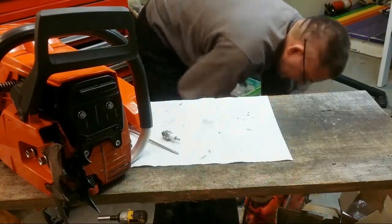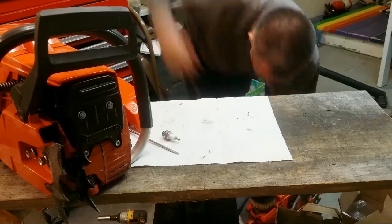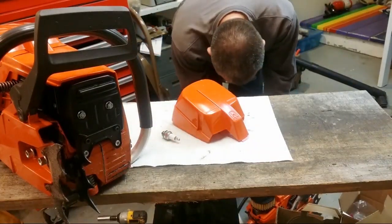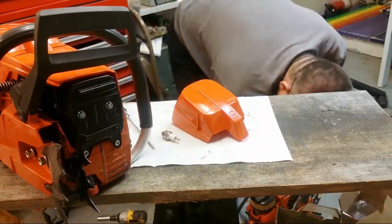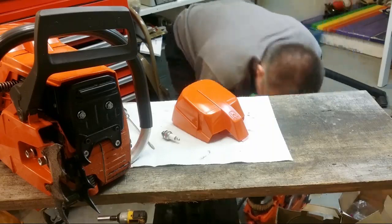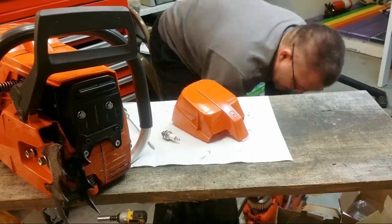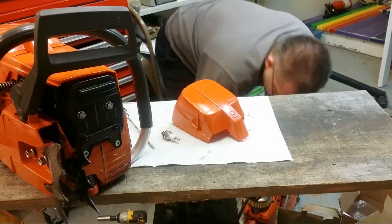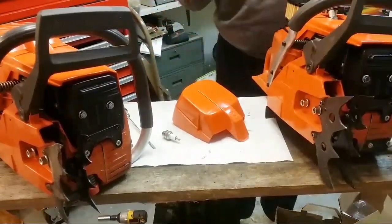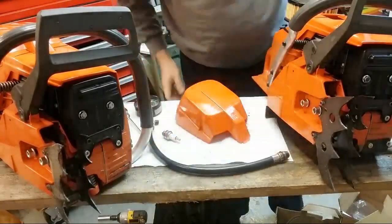So I've got the decomp already in here. Nearly 150 with the decomp in. Let's pull the decomp out. Oh God. 175-ish. Let's see. 175, somewhere around there. I forget all that went into this.